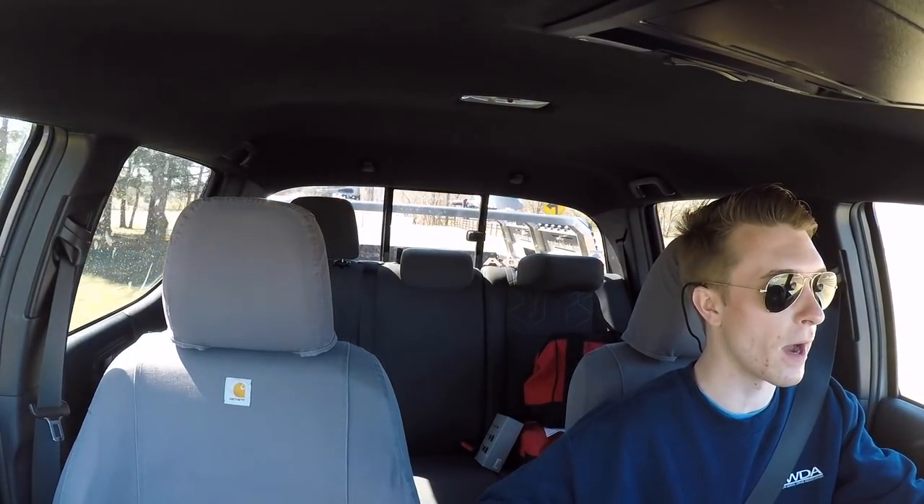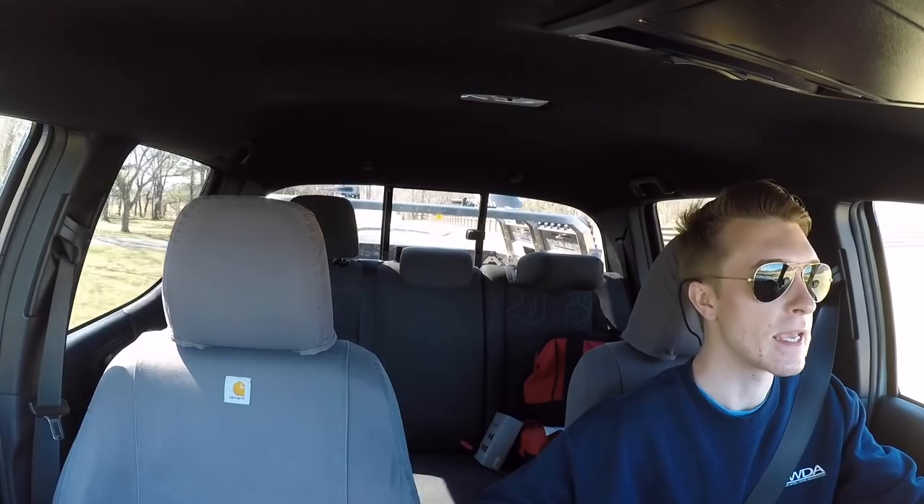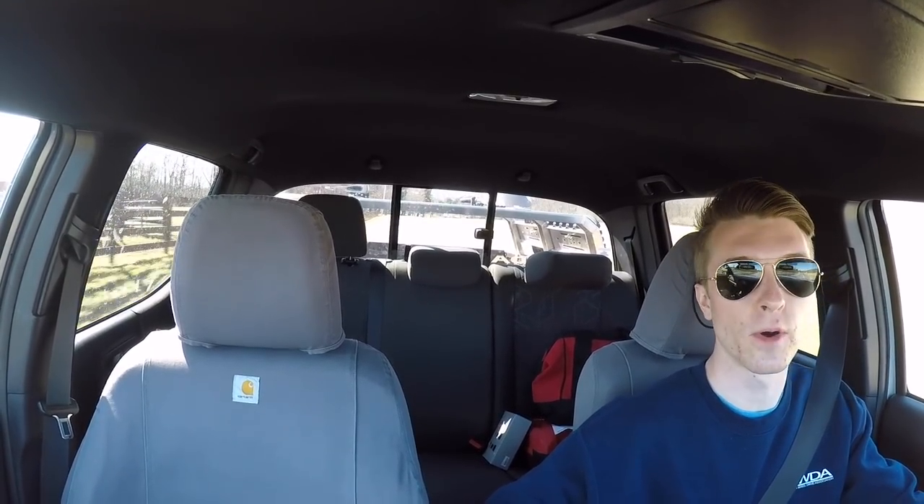There was no reason for doing this other than I just recently hit 45,000 miles. The reason I'm doing the exchange at 45,000 miles is because I have done not only a decent amount of off-roading but I have also towed a fair share and hauled a bit of equipment. Over time, as that transmission fluid heats up and cools down, it gets used and will eventually start to get darker and darker, and that is something I wanted to prevent.